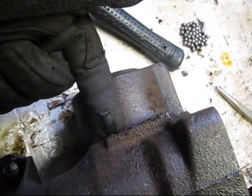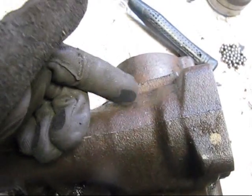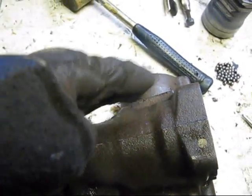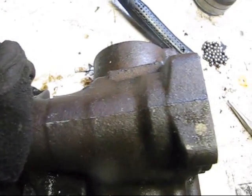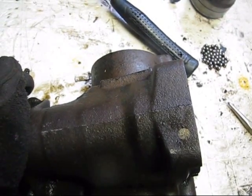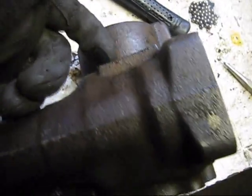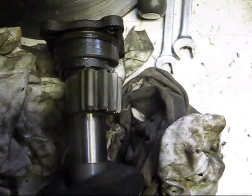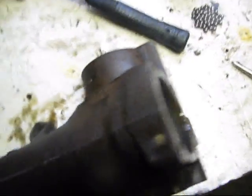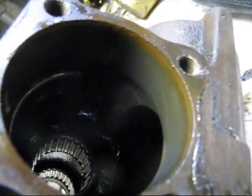And I think I'm going to put it back here, right there. I think that'll work. Because I've heard people put them here and then when they got bigger tires on or whatever, they start to smack it, cut the tires up, and or break the fitting off, which would suck. So yeah, I don't know, either up front here somewhere or on that side. The only thing, I don't know if it's going to hit the teeth or not. I don't think it will, but I don't really want to take the chance, because then I scrapped another power steering box.